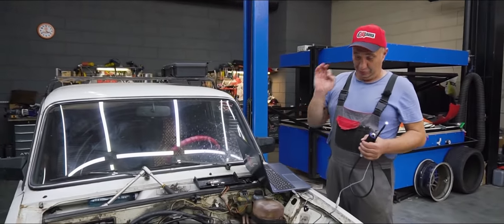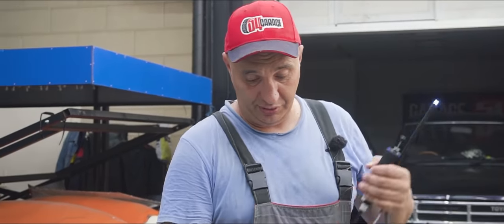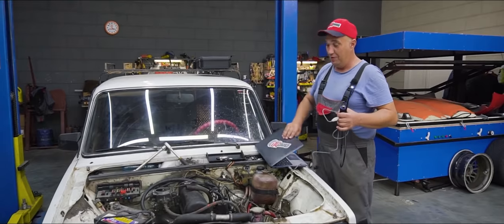While there is no plug, let's load a ball in there. Then we screw the plug back in, start the motor, apply throttle — without too much enthusiasm, though. Then we remove the plug again and see if there are any marks on the piston. Let's do this.